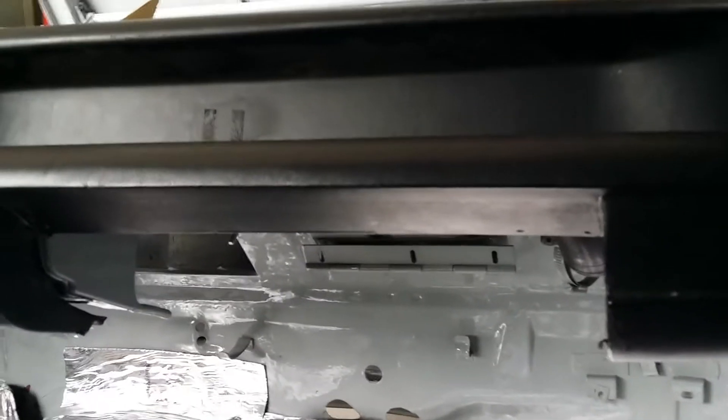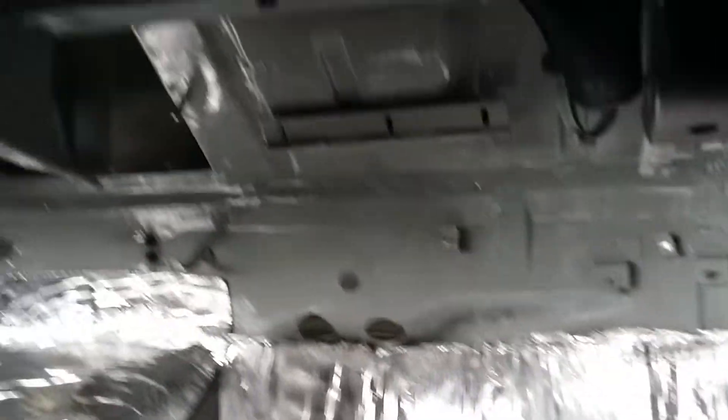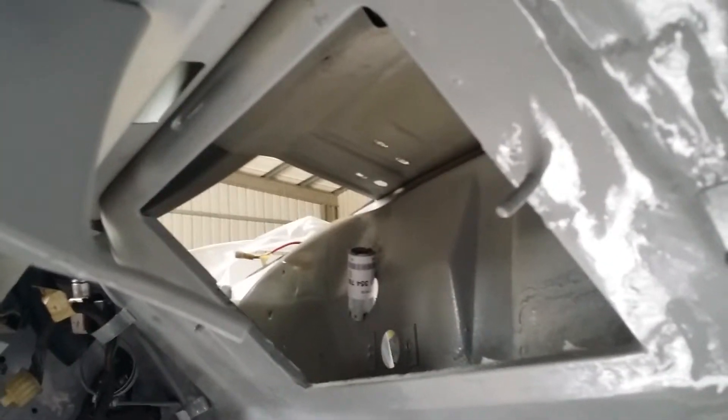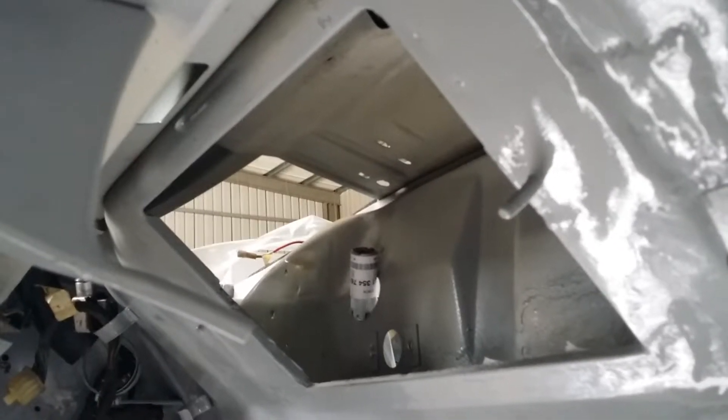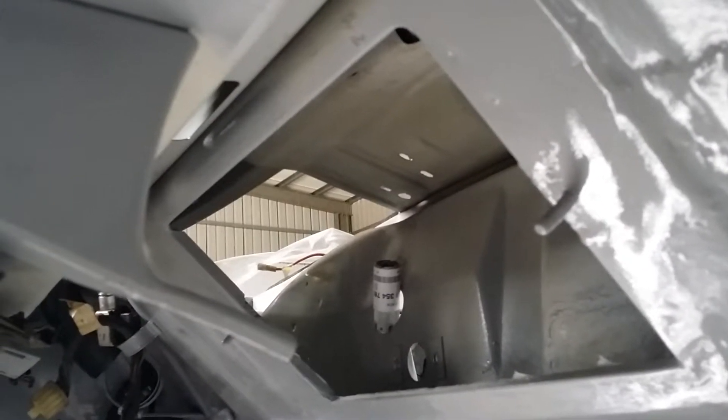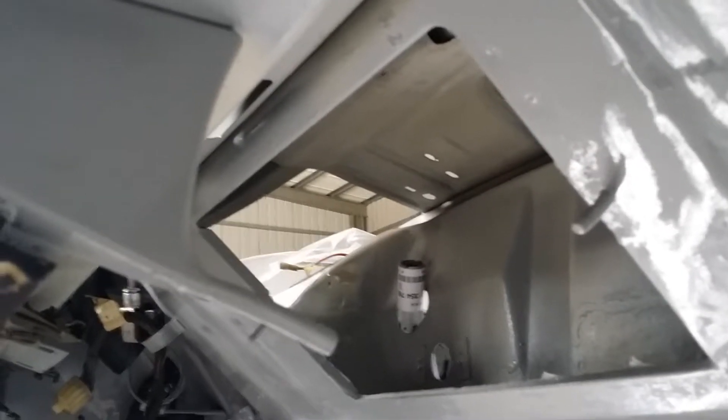I've got the dash roughly in place. The glove box isn't in great condition — probably just going to have to tidy that up a bit and that can go back in, but that's just three screws, so it's a very small job. I can't do much else under the dash because the heater matrix components — we have to order both heater matrixes for both the 2002s, as they're very much broken. The plastic surrounds and things are no good, all cracked and split. They're not going to hold in place and they're not going to seal properly.